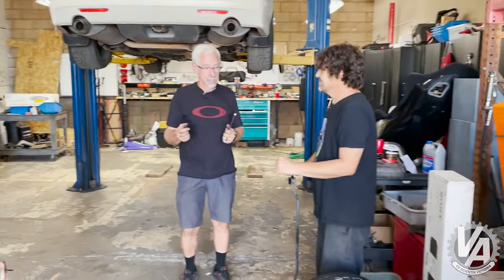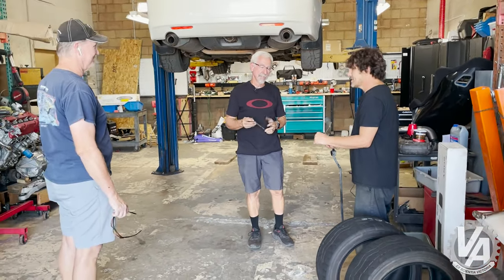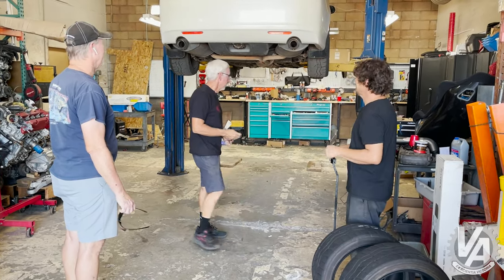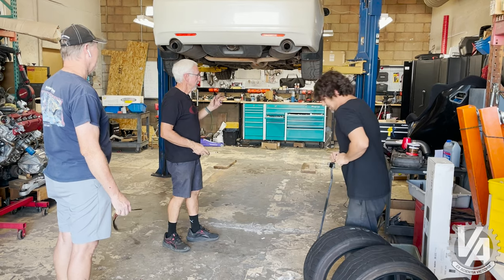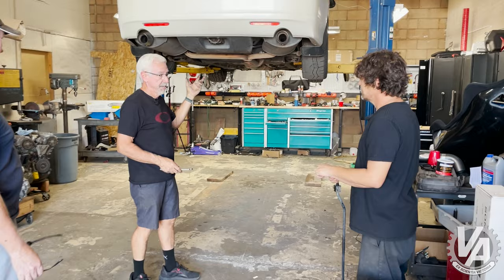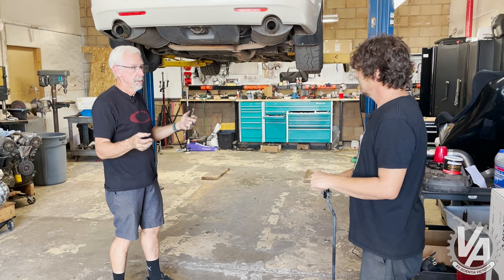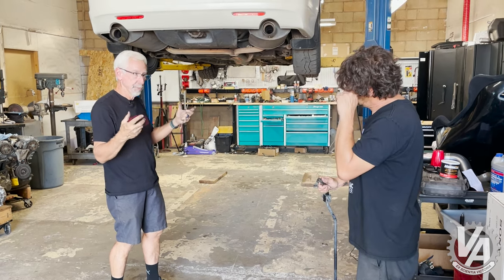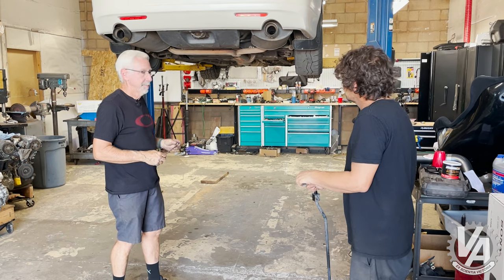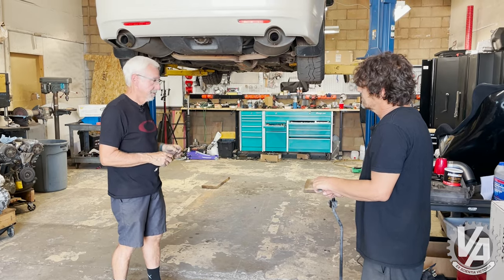The solution on a loose rear is to steer into it and gas it — and that's not what you want to do, especially if somebody stopped in front of you with only 10 feet to spare. So for now, we'll put the rear sway bar on and figure out how it handles. If we need a little more handling at the track, we can disconnect the front sway bar, stiffen the rear sway bar, or stiffen all the springs at some point. But at the track, stiffening the rear or taking out the front is going to be the solution.